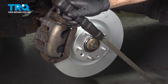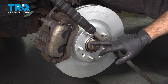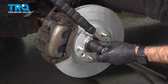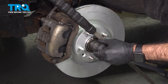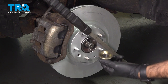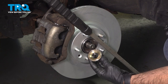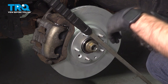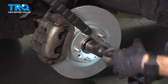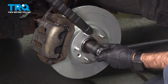We're lowered down to the ground because we're going to use a pry bar between our studs to stop our hub from spinning. Before we torque our axle nut down, we're actually going to take it back off, put a little bit of oil on the back side, and then torque it down. So again, this is a 35 millimeter. We have our axle nut — we're going to put just a little bit of oil right here, put it back on, and torque it down. To speed up this process, we're going to use the impact. And now we'll come back and torque this nut down to 202 foot-pounds.